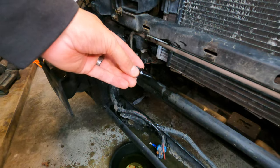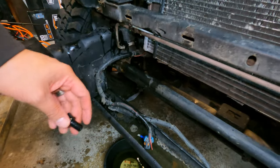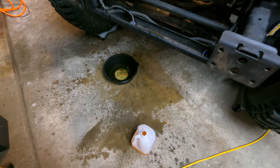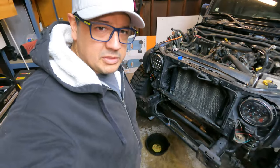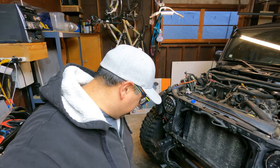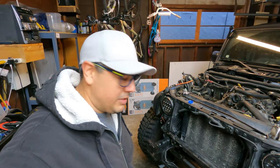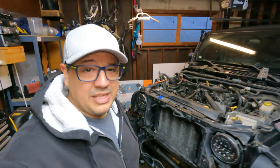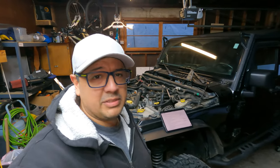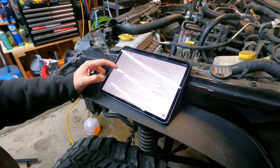Something interesting happened when I wanted to drain the antifreeze. I thought that this little spigot coming out right here — when I turned the knob — would have drained out right there. But apparently I'm a little wrong there, because when I turn the knob it just drains out of where the knob is unthreading from. I may be doing that piece wrong, but nonetheless I got it started and I have a gallon jug under here. I was able to get the plug out. I still don't know why it wasn't coming out of the little spigot. It is drained out — I didn't get very much on the floor. I thought I'd get about a gallon and a half but I don't even think I'll fill up a gallon. We're swapping out the engine anyway, so let's count that step done. We took off the underbody splash and we drained the coolant.